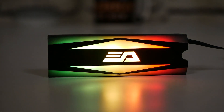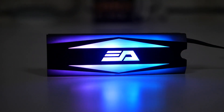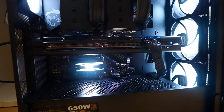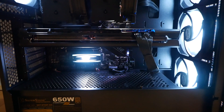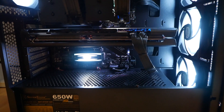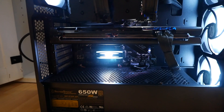On to the results. The visual results — as you can possibly see from the b-roll — it looks fantastic and certainly adds a little bit of underglow to the PC in an area which was previously pretty dark. Now the actual temperatures are where things get a little bit interesting. With the bare drive we had a low of 26 degrees C and a high of 59 degrees C — just a shade under 60 — which is still within the drive's spec but a little warm for my liking.